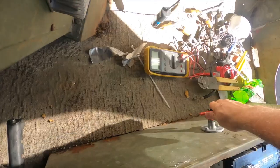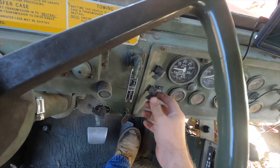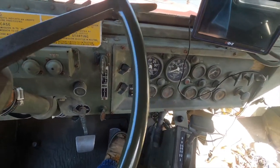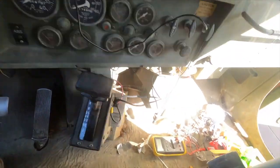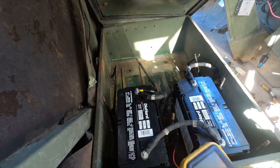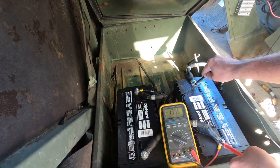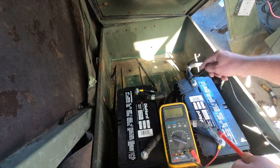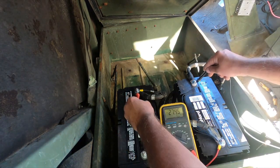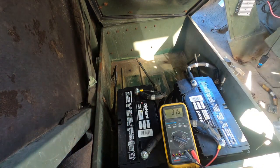Here we go — turn on the switch, power it up, and it sounds like we have power. That started better than it ever has! So yep, we only need two batteries. Going back with the meter — we have 13.75 volts across one battery and should have the same on the other. From here to here we have the combination: 27.46 volts. We were only getting 18 volts out of the other four batteries, so this thing starts up like a champion.